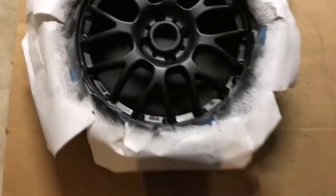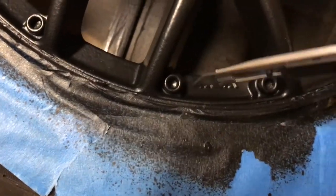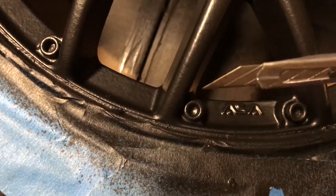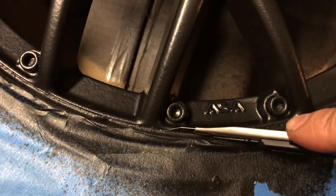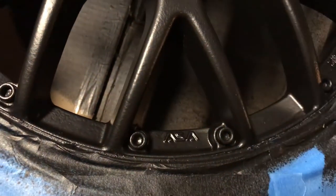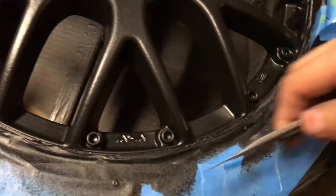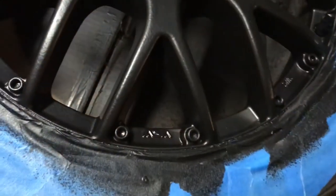To take off this tape, your natural inclination would be to just peel it off, but from my past experience that's a bad idea. What you want to do is take a razor knife and cut along this edge where you want to remove the tape. That gives you a clean break so the dip doesn't pull and peel off when you start to peel the tape. That's a mistake I ran into before. I'm gonna peel this off and show you guys the final product — maybe if it doesn't look very good I'll just respray the whole rim chrome edge and make the whole rim black.